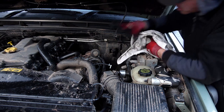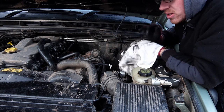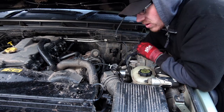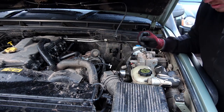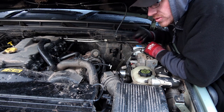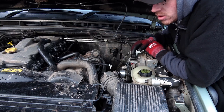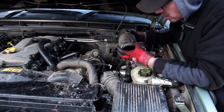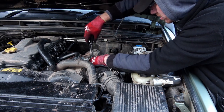That's it. Need some new gloves now — oil filter's back on. Obviously because we have lost a little bit of oil, once it's all back together, obviously need to run it up, make sure the oil filter is full, and then turn it off and let the oil settle in and we'll dip it. Because the last thing you want is to run it dry of oil. Getting the air feed back onto the turbo now.